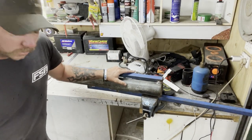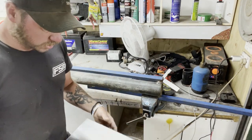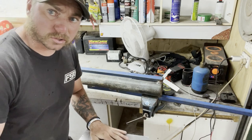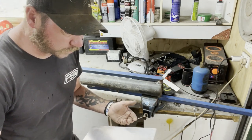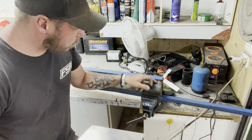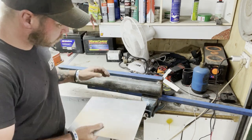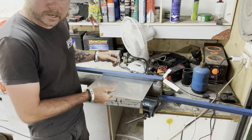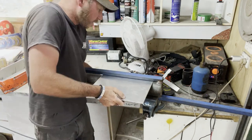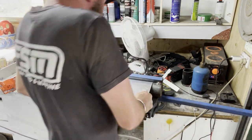The pan's a bit short and I've got to make the bottom where the back is. I've cut the piece at 320 - that's the measurement we took - it's 320 by 230. The pan is actually only 215, so I've made it 15 mil bigger so when I bend it, it matches up to the sides. I'm making it out of 3 mil alloy. I'll introduce you to a little jig I made up back in the heyday to help bend materials. You just slide it in - it's got a little groove in there - put it in there and bend down on it ever so slightly as you go along.